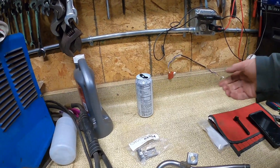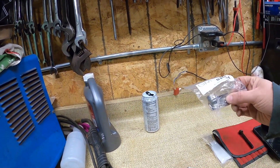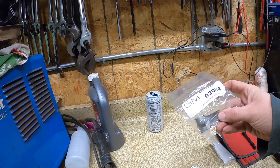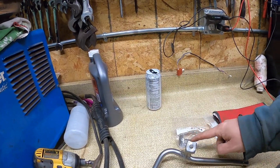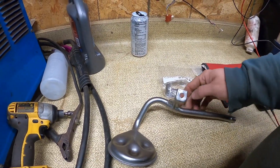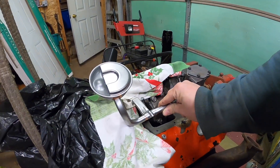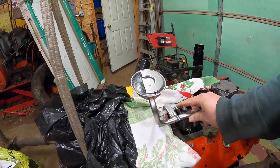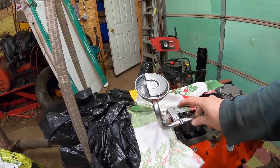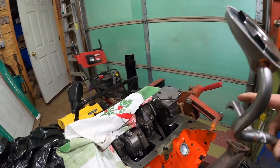You're making this a front sump. You can buy the bolt from Classic GM — that's where I got it — and you can also buy this adapter and swap it on. What I did was just a little modification with the hammer and the vice; I bent it. Now I need to figure out where I need that positioned, measure off the other one, drill my hole, and cut off the excess.